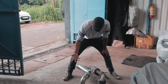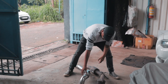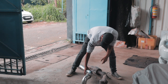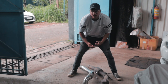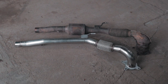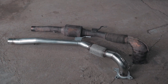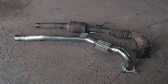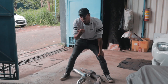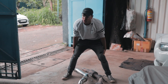A few cool things about this custom-made downpipe: at the top it's 3 inches, it comes down to 2.5 inches, and after that the whole thing is 2 inches. Those two steps of reducing the size and radius of the downpipe help reduce turbo lag, so virtually there will be no turbo lag and the car can pick up from even 1,200 RPM. Since turbo lag is quite a big issue in these old Skodas, this will hopefully solve most of those problems.